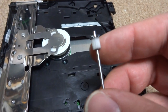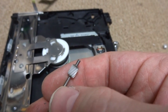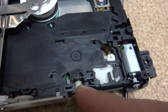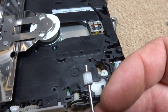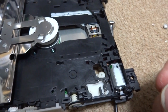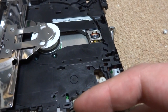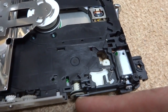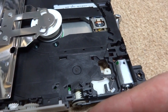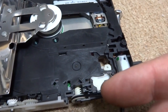I've taken this out and tried to go in between these grooves to file them down, because they wouldn't sit snugly inside. This was causing it to bind up. I've got the inside parts smoothed out a little bit more so it should turn smoother. It's probably not going to correct the problem 100%, but hopefully it'll make it a little better. I'll try adding just a little bit of lubricant - though I don't want to do too much since it's near a belt. That should help smooth things out and make it less noisy.